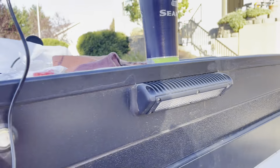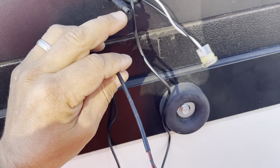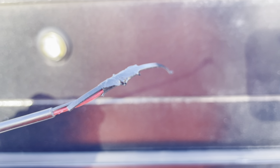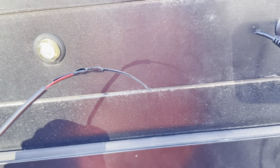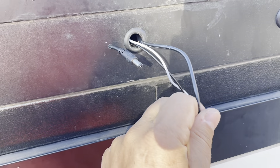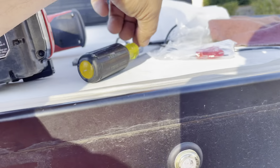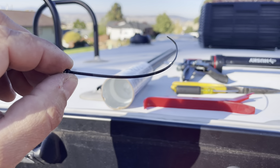What I'm going to do now is wire this into the trailer. I'm going to push all this extra wire back in, and then my camera will plug in here. I used the electrical tape, taped it to the black and red wire, then stuck a zip tie through the 11/64 hole until it was revealed, and grabbed it with the needle nose pliers and pulled the wire out. That's how I fished the wire through the hole. I was pretty happy to finally use those little zip ties that are never good for anything for something useful.